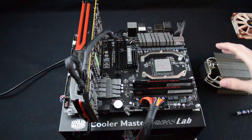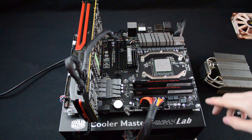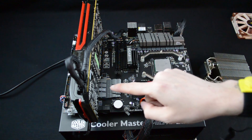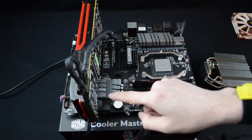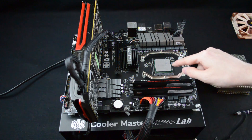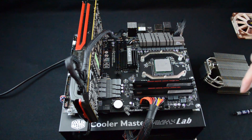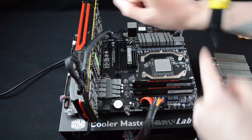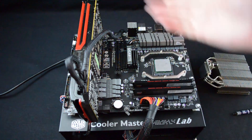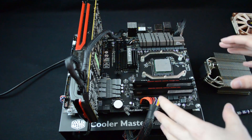So here is the test bench — we'll quickly go over what we've actually got here. Provided by Gigabyte we have the 990FX-A-UD3 motherboard. AMD provided us with the rest of the parts, so we've got the AMD Radeon HD 7970 right there for graphics, and we've got eight gigs of RAM here. The CPU is an FX-8320. More details about all the specifications will be in the video description. One of the things I want to point out is make sure when you're doing this kind of stuff you get yourself earthed — I'm clipped to this because it's plugged in but not switched on. You want to make sure you've not got any static going on when you're messing around with your processor and all that sort of stuff.